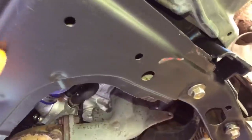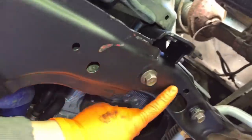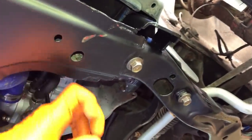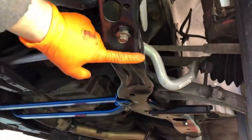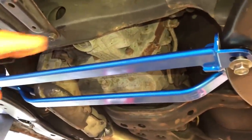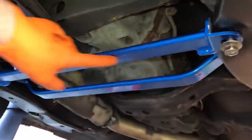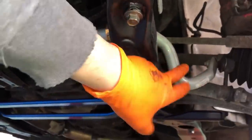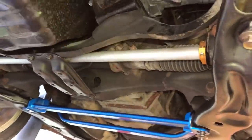What I'm doing today: the car didn't have a subframe — this big part here all the way down to there. It didn't have one because they go wrong and people just take them out instead of getting a new one, because they're not structural — they just stiffen up the front end on the STIs. So I've got all the fitting kit and we've got a new subframe on there now. We've also got a nice H-brace — a Cusco style one, though not a real Cusco. And we've also put in a Whiteline front anti-roll bar, similar to the ones I put on the Astra.